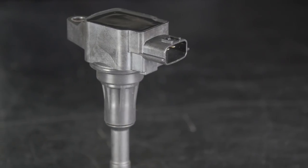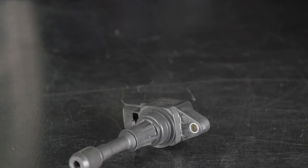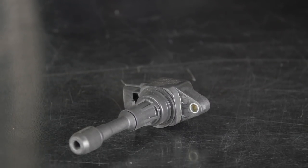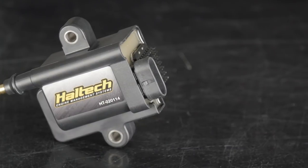Now onto ignition coils, where there are two main choices: coil-on-plug and coil-near-plug. Coil-on-plug with a built-in ignition module is certainly my favourite. The coil is mounted directly over the spark plug, so there's no need for a spark plug lead, and the ignition module is part of the coil. The Nissan coils found on the R35 are a perfect example — hugely powerful, super easy to wire, and ridiculously cheap for the spark energy they provide. If it's not possible to mount this style of coil, the next best choice is coil-near-plug, but still with a built-in ignition module.